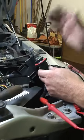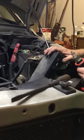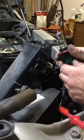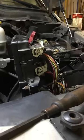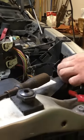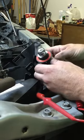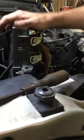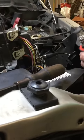Basically what this issue is — it's an 06 Ram, 1500 with a 3.7 liter. This box is the problem. The driver going to this headlight is bad. Whatever happened, this box, this control module, at one time detected too much amperage coming from this side and just took the circuit down. So what it does is it shuts the driver off to this side. How do you fix that? You don't. You throw this in the trash and spend $800 buying a whole new brain for the headlights — very expensive just to fix one driver.